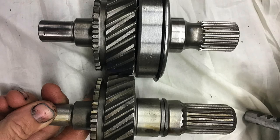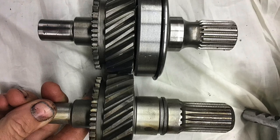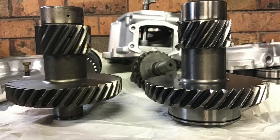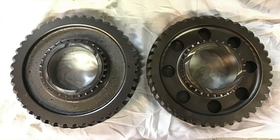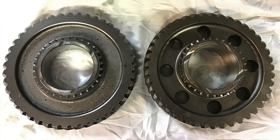In this picture here of the input gears, Marlin being on the bottom — it has longer splines and there's no neck-down section. The idler gear, Marlin on the left, has a wider output gear and also has oil drillings in the leads to oil up to the roller bearing. The output gear, Marlin on the right — the drillings make it lighter and lift oil to the top of the case.